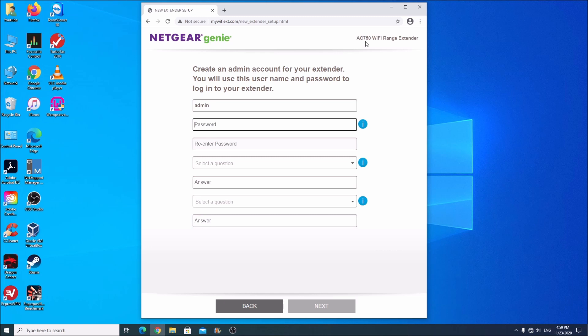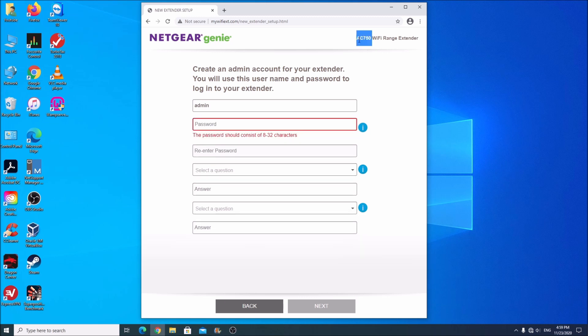If you want something more powerful, buy the more expensive ones — above AC1000, AC1100, or AC1500. These devices operate in a gigahertz range: either 2.4GHz, 5GHz, or dual-band like this one, which supports both. When we're talking gigahertz, 5GHz is more powerful than 2.4GHz. A lot of devices trying to stream media like YouTube are having a hard time on 2.4GHz. So 5GHz Wi-Fi is always a good option, and always get the most powerful one if you want to stream more.